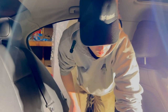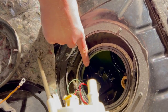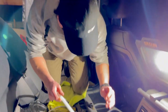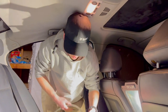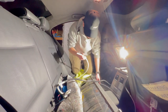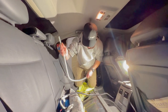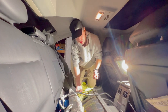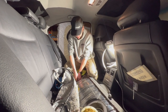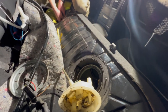Now we're in the car on the driver's side. Over on the passenger side is the fuel pump, bucket, and top hat we're replacing. We'll take the supplied lines from Precision Raceworks and cross them over through the tank for the return and feed. It's easier to do this before clipping them onto the new top hat. Running the return line first — reaching through the tank — hopefully it stays on top and threads through.